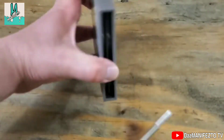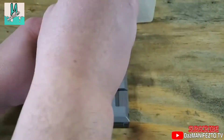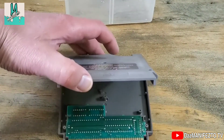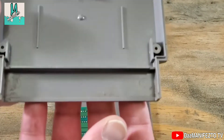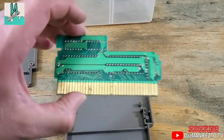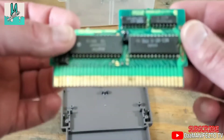To get into the cart, we will need to remove three screws with our 3.8mm security screwdriver. Toss those screws in a bin so we don't lose them. Carefully lift the case so we don't break any tabs. This could use a little better cleaning as well — pretty common in these old games. This is most likely what's causing the problems. It's my theory that this corrosion is caused when people blow into their carts instead of cleaning them the correct way.